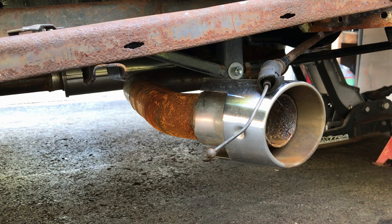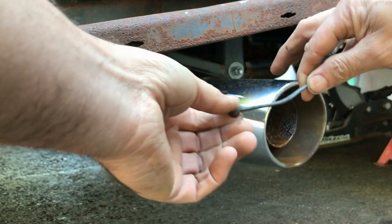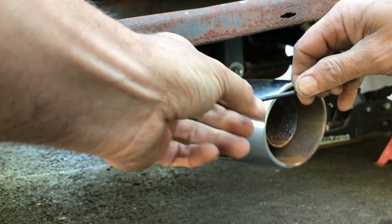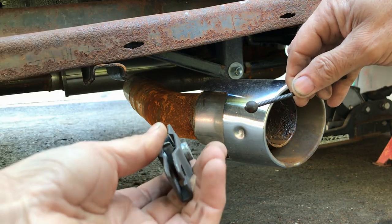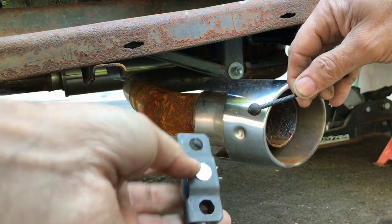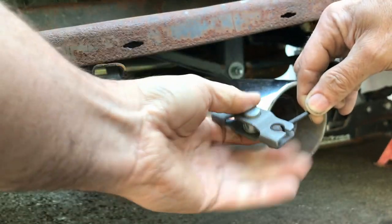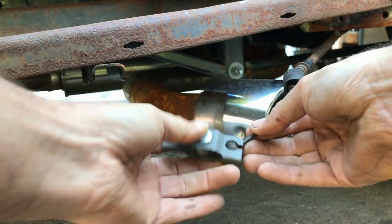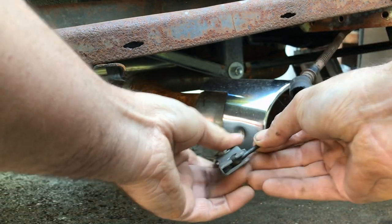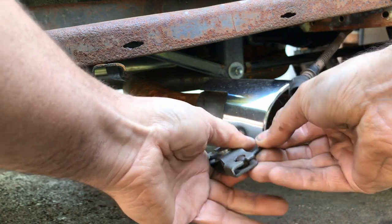Right, let's get underneath, see what the cables look like. Right, I crawled underneath and I pulled out one of my cables. So you can see the end is a little ball. And I took the clamp off the handbrake lever, which is a circle with a slot. So it will go in. However, this is obviously designed for a cylinder end, not a ball. So the danger there is that over time that would open up that gap and pull the cable out.